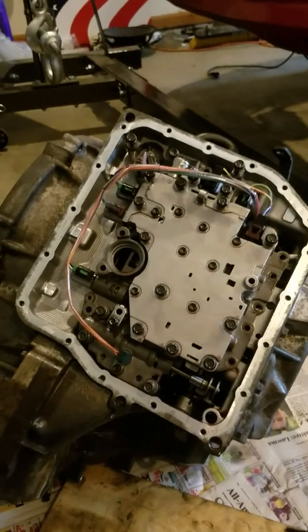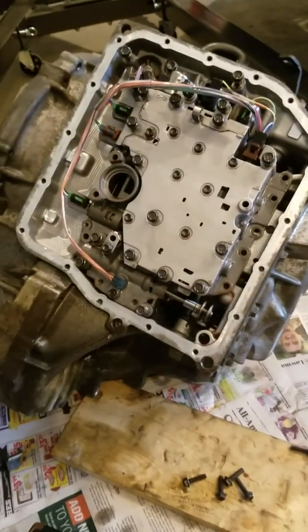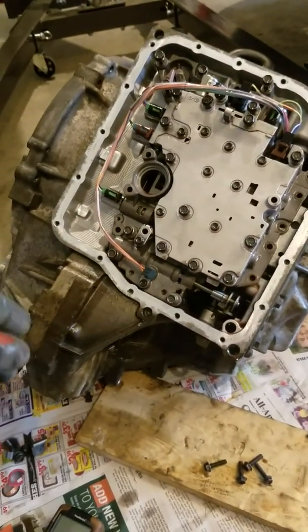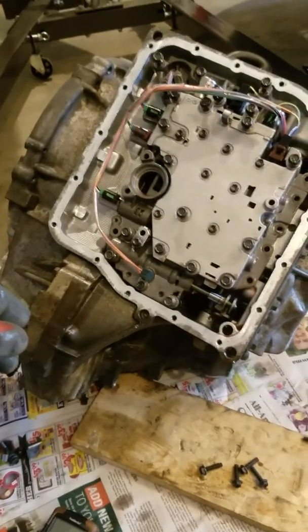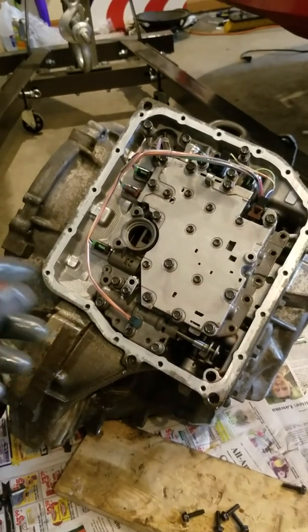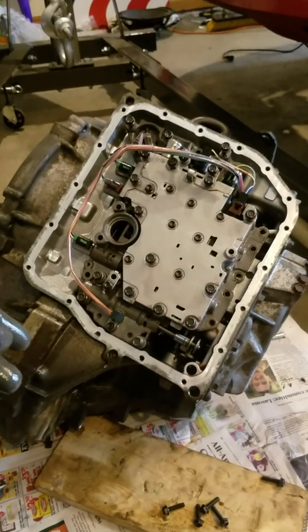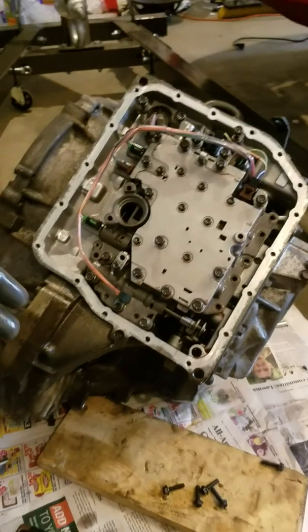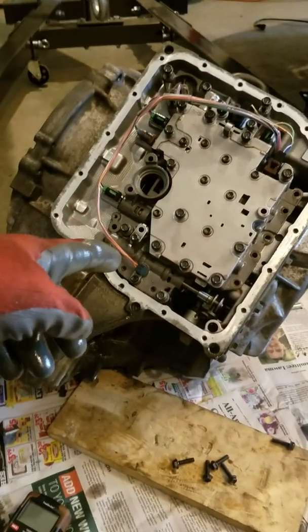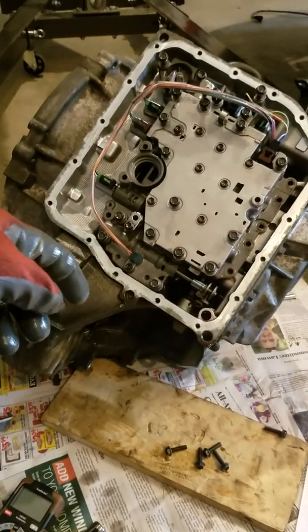There's still a lot of work to get done to put this all back together. I've got the motor completely torn apart, so it'll be a little while before I can confirm that this resolved the issue with the P0748 pressure control solenoid A electrical DTC trouble code, SL1 solenoid. The problem it was having was basically not getting first gear pressurized to make the vehicle move. I've got a new computer in the car already — ordered that online, which is a different topic because it came with sand in it. I've taken this valve body out before and cleaned it all the way through, making sure everything was functioning and springing the way it's supposed to. So now I'm just going to button this back up.